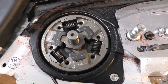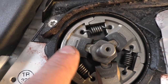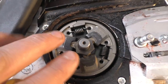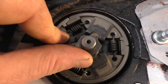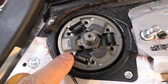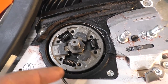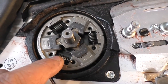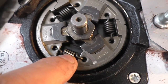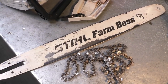To take the clutch off you have to turn it clockwise. When you put it back on you turn it counterclockwise - it will tighten itself up when the saw is running, but you have to have some resistance so that the clutch tightens itself up properly on the shaft. Even if you had never taken the clutch off and you rev the chainsaw up without a bar and chain, it can still work its way out and come right off. If it loosens itself from the crankshaft and comes off the saw, you can end up damaging the clutch and losing all these little springs.